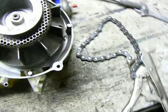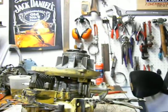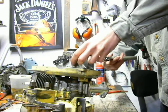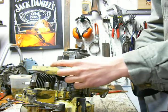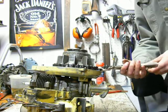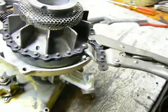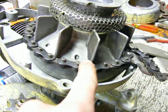Something like this strap wrench is very versatile. I'm going to set the camera down for a second because you need two hands to put the wrench on. You just get it to the right size and loop it over. On this saw — this is a chainsaw, an old David Bradley — it's a little difficult because this lip here gets in the way, so I can't put the strap all the way down on the flat part of the flywheel. I'll just adjust it and click it down gently; you don't need to crank it too hard. I can't put it all the way down on the flat, which is what I would like to do, but this is better than nothing.